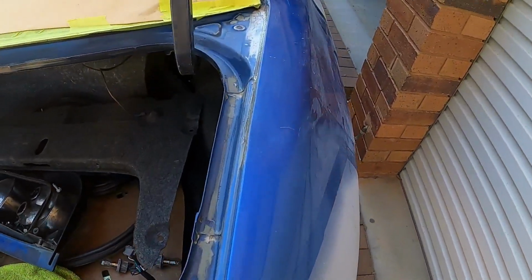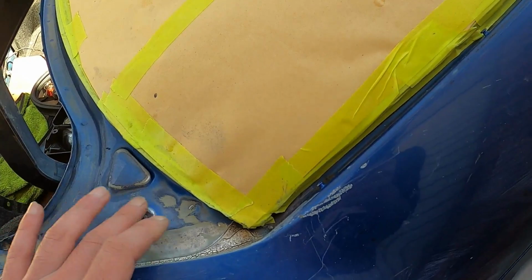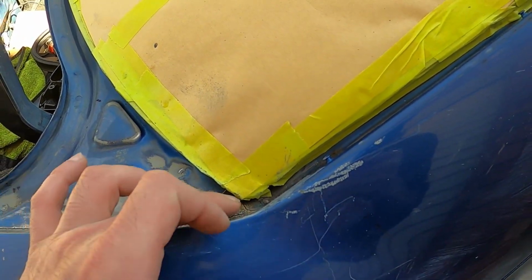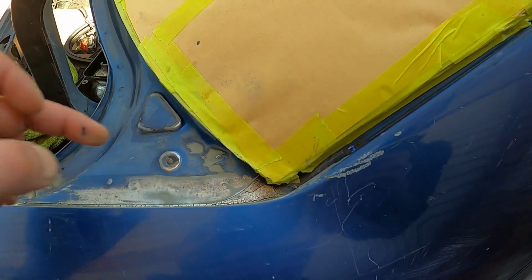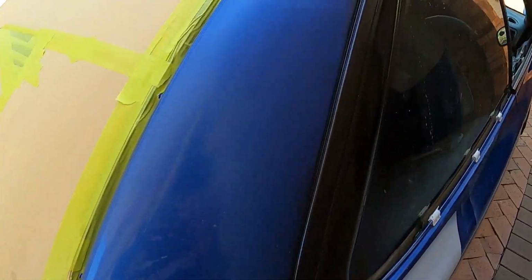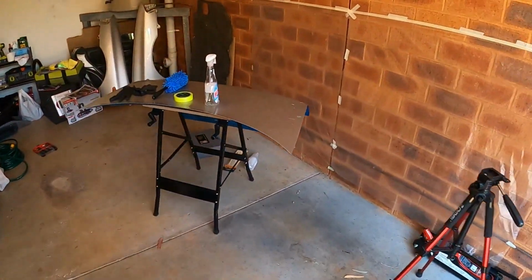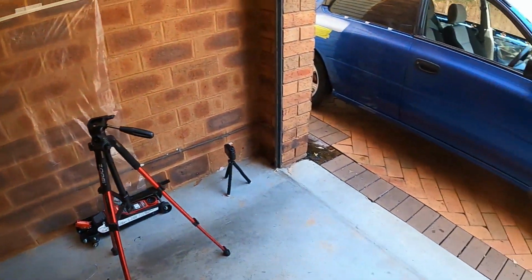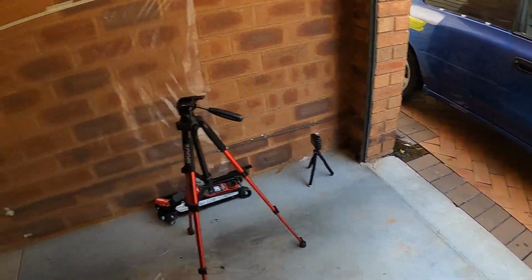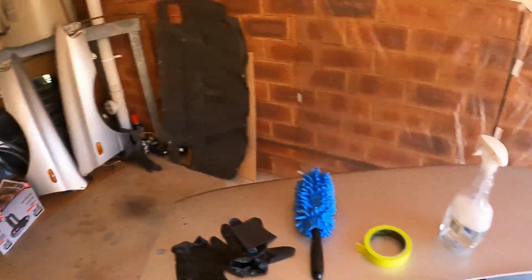The plan is once it dries, I'll put wax and grease remover, and hit it with the primer over here just to protect it. Once that is done, then we can go with the paint. I'm not going to paint it now because I need to put it inside the garage. I don't want the elements to impact the perfection of the paint, so let's just leave it outside for now. Work on something else. I don't know, let's work on the fenders and see how that goes.